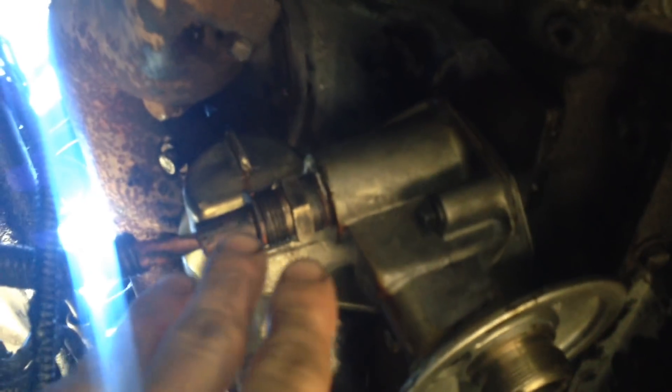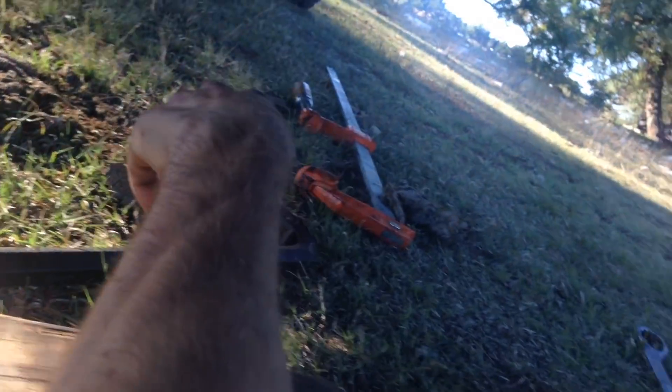The hardest part of putting it all back together was squishing the two sections together, because remember they were pressed together when we pulled it apart. Using a pry bar and a big wood block, with the rear end already put in — that was actually pretty easy to do off the vehicle. For the front end, we put a wood block between that section and the component itself and were able to force it onto the cooler and get everything put together, and that worked well.